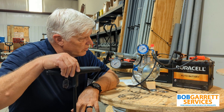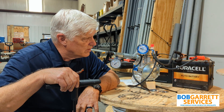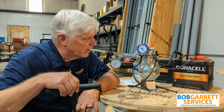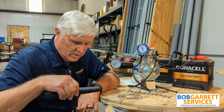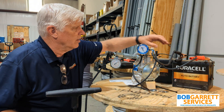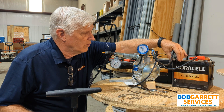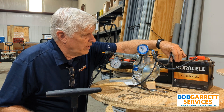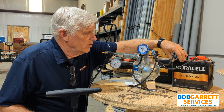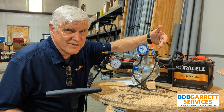Now, let's go with 35 inches of water column, which sometimes can come from a regulator that's imperfect. Here we are at 35 inches of water column. Let's see if our 12 volts will pick this solenoid. It will not. What that means is that we are going to get an 1100 error code. Thanks for watching.